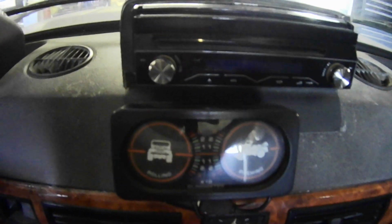And yeah, that will conclude today's video. A bit shorter video. I hope it helps somebody. I bet there's other people with problems like this, a warped front on their radio. Basically it's scrap because you can't do anything with the front. So by drilling three little holes in that, it's made it usable for a while, and I can still access it to get at the USB plugs behind. And if I leave it for any length of time, I can actually take these pins out and take the front off. But yeah, well chuffed with that.